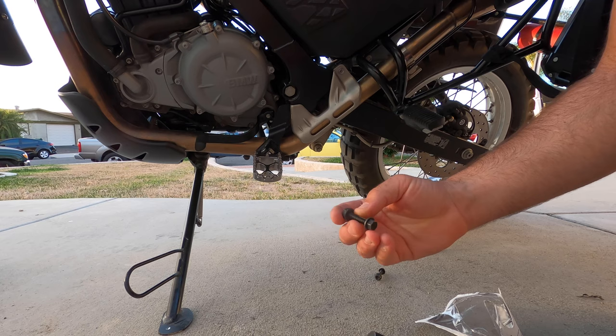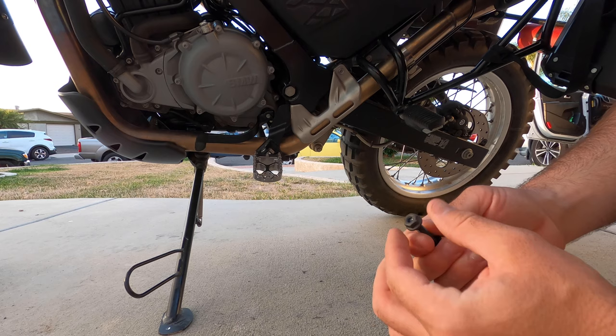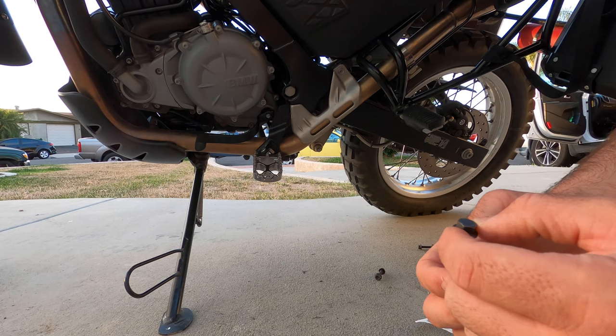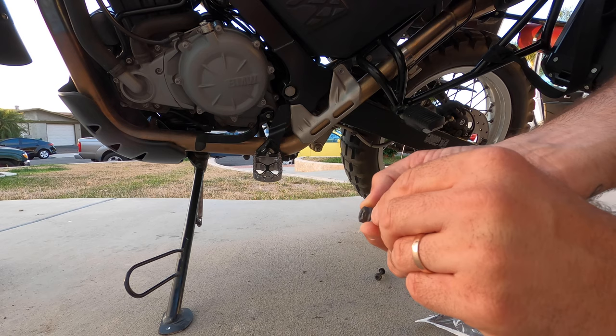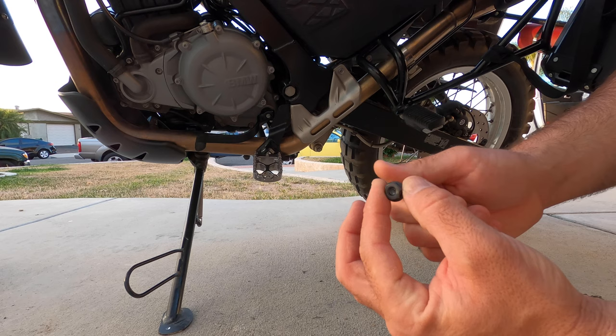Get an inch and a quarter grade 8 bolts. Grade 8 is a bit stronger than grade 5. The tensile strength is higher as well. They are more resistant to strain, and be sure to get ones that will not rust. Nowadays, these bolts come with a pinched nut, which acts as a locking system, thus eliminating the need for nylon or metal washers. And I still suggest using a dab of thread locker, but more on that to come.